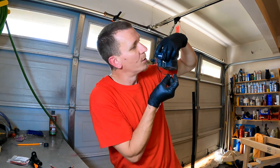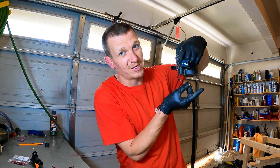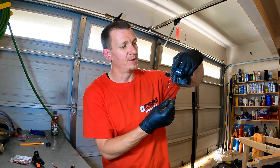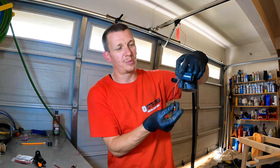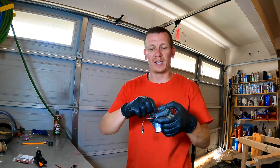You can see — watch when I blow on it, get the air coming out, and I'll apply the 9 volts. You can see how it got stuck right there when it was opening. That's why we replaced this one — because of the intermittent fueling problem. When 9 volts is applied you'll hear it open and shut.